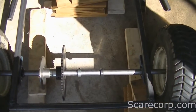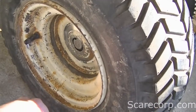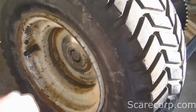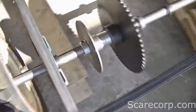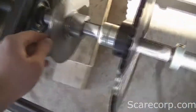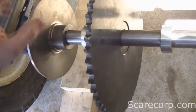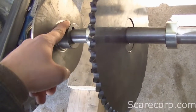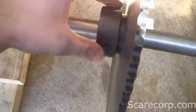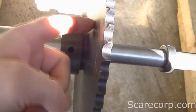I went with a one-inch axle on the back — it's a 36-inch and it doesn't have any threads in the back, so I can't put a bolt on here. I'll show you exactly how I plan on doing that when the time comes — I'm not going to weld it, there's a trick we can do. It's a keyed axle, so I can put my key stock in here and lock it. My sprocket came off — I had to buy a separate hub for it, but it's keyed as well and you'll need to weld the hub to the sprocket, which we'll do at a later time.